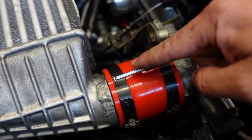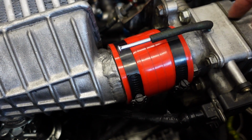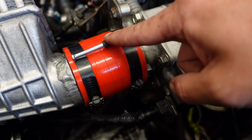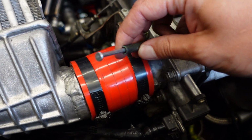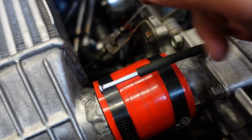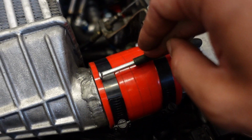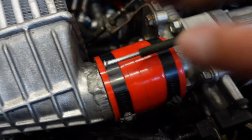This used to be an air intake, a vacuum hose. It took air from after the air filter, obviously when boost occurs. Now there's air coming through this, so I plugged it up very elegantly using a nail, but this will be replaced with something nicer. It's probably going to do this when the engine is running, and it's going to sound like rod knock. What else we have?